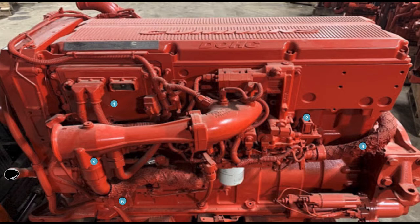Number three is the EGR piping that comes around from the other side of the engine, from the EGR cooler. Number four is the EGR Venturi. You have to remember that the EGR system is going into a system that already has pressure — the boost system. So they have a Venturi in there, sort of like blowing over the top of a straw will pull liquid up the straw. Same idea.